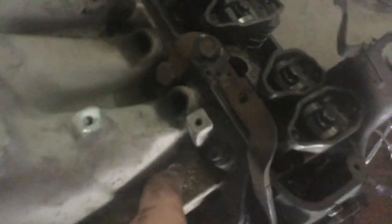It's been probably 10-15 minutes - it's 10:02 right now. I've pulled out the injectors and fuel rail, got the other side manifold off, put the lifting point back on, pulled out what I'm not sure is a filter or a regulator, pulled out the fuel lines. I'm putting out the bolts - actually I need to keep them. These are the bolts for the fuel rail, I'll put them over here because they're important.